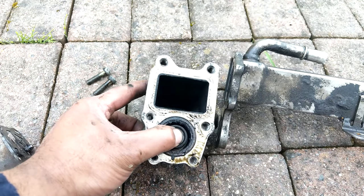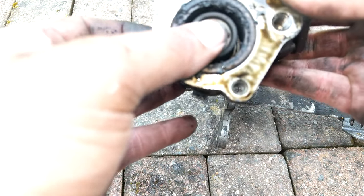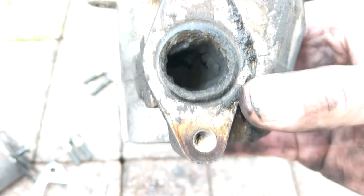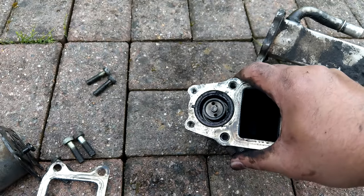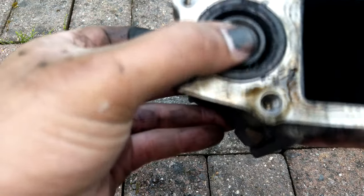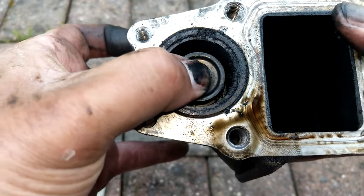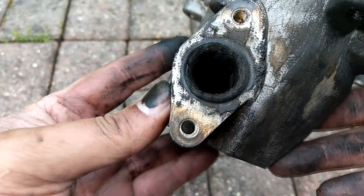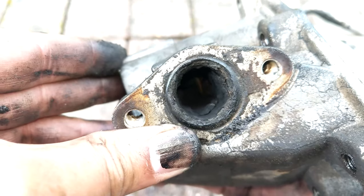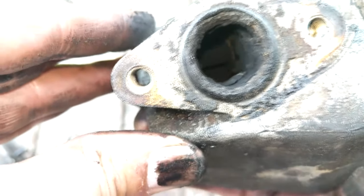And this was the smoking gun — the valve was completely seized. I'm not a weak man, but there was no way I could press it in with my thumbs. It was completely coked up inside; you can't even see in because of the amount of carbon and soot. In the end I got a half-inch socket extension and off camera gave it a little whack with a hammer, which freed up the valve. As you can see it's spring-loaded, with a natural resting position. The actuator then presses the valve to allow the correct EGR flow.